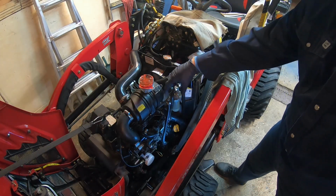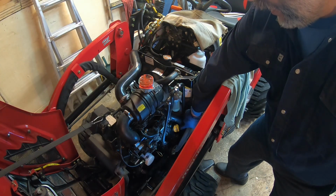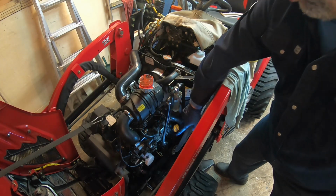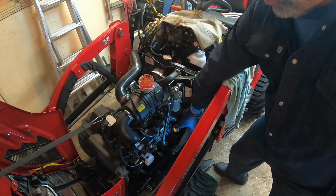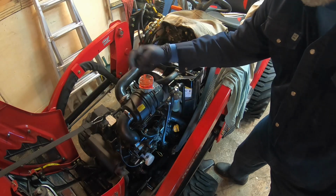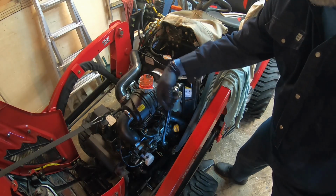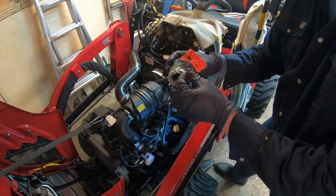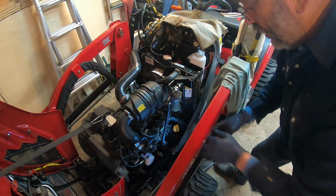This is the fuel filter right here, and right under it is another filling port, for the oil. Of course, when I remove the filter, this diesel is going to fall on it and maybe contaminate the oil from the engine. So either you can put a big rag in here or a piece of steel. In my case, I made myself, from an orange juice bottle cap, an inverted funnel, basically a protective cap. Before that, make sure you clean everything around.